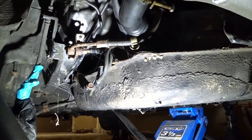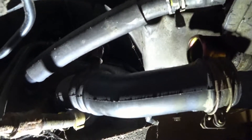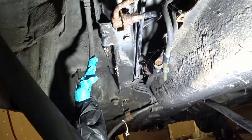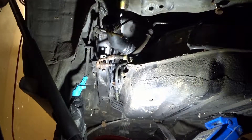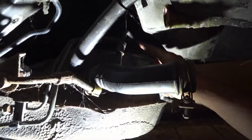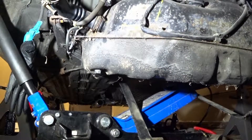As you can see, this connection is on top of the tank — I think that's a 14 or 17 millimeter. I'll loosen it from here. This is the vent for the charcoal canister, which I believe is underneath this cover. I just have to take that line off and then I can get to the bolts on top of the tank, which I believe are a 14 or 17.